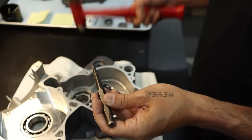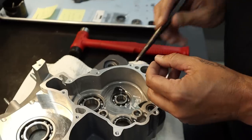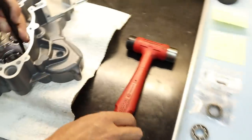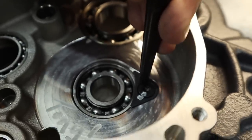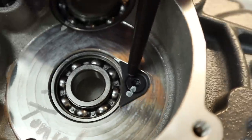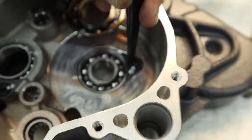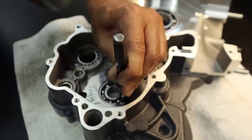That's okay too. I got my special tools. Got my center punch and my hammer. I'll show you guys how to peen over a screw head, in this case these bearing retainers. So I come in here and I find the edge with my punch. Can you get that, Charles? Yeah, it's a better lighting edge. I go over to where the screw is. Just get the edge. Can you see that right there? There's the edge. Then I'm going to go back onto the screw, bringing the screw and the retainer together. And then I'm going to mash it like this, kind of angle the punch.